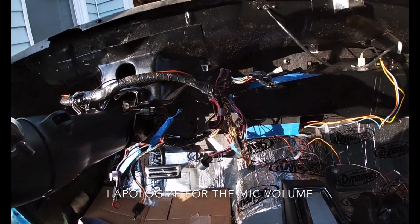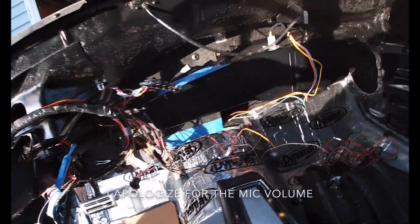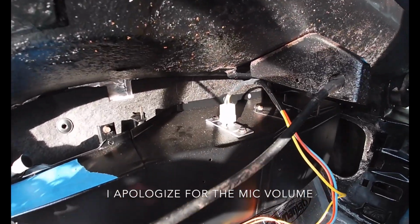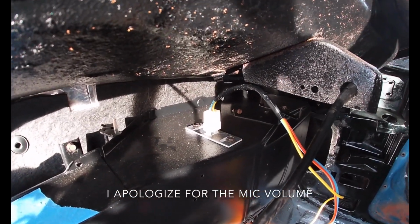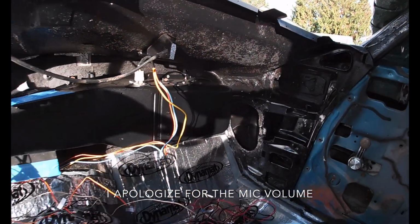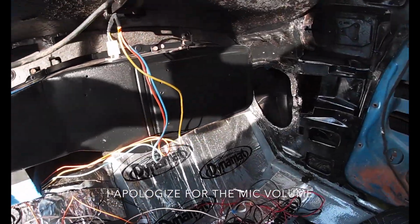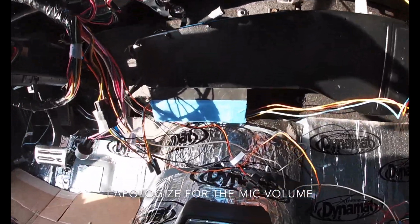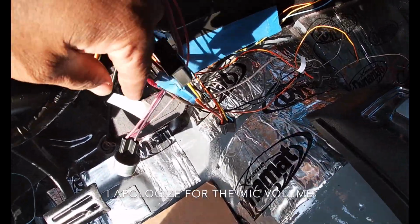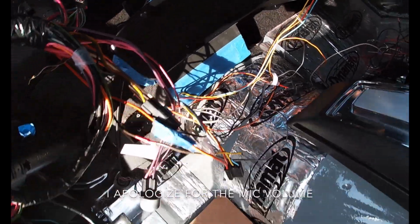What else? So got that installed, everything's labeled. Oh, and from the previous clip, this is what I did. That's what I was actually trying to replace. That came off the old harness that plugs into the heater box, into that little resistor there. So I had to take it off the old harness, tie it into this one, tie it into the bulkhead, and then solder it together. Right, where is it at? It's somewhere over here. Oh, right here. So this is where I soldered it together, and this part plugs into the back of the climate control when the dash is hooked up.